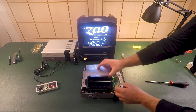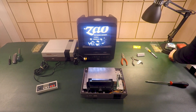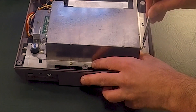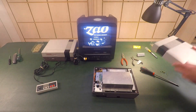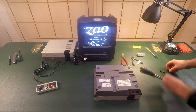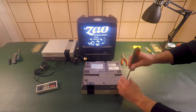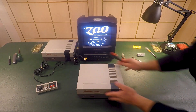Reassembly for your metal shield uses the seven screws to hold that shield onto the circuit board. Last step, you're going to take your Nintendo top shell, install it on top, flip over, and then reinstall the six bottom screws. Reassembly is complete.